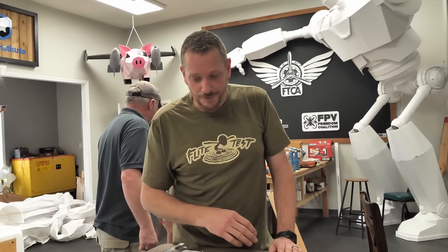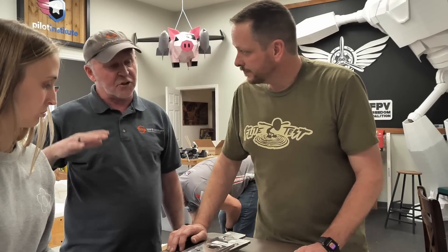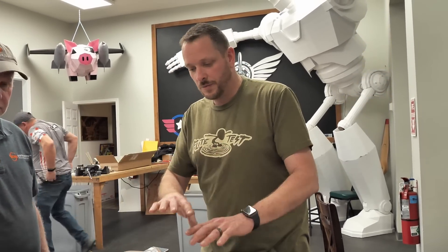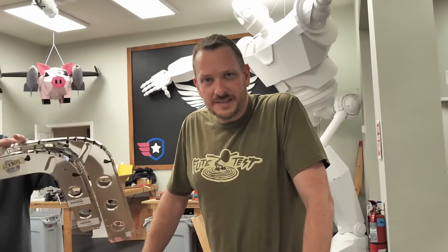Part of the tail kit includes not only the horizontal and vertical components but also the tail cone. These parts here are bulkhead sections that go in the tail cone. As for keeping them nested together — it's your choice, though personally the recommendation is to take them apart once you have shelves. You do need to verify all the parts are actually there. We'll identify them, build the shelves, then unwrap and inspect them before assembly — like the old rule: don't pop out all the pieces.